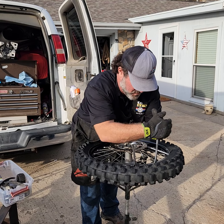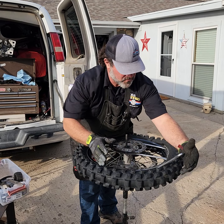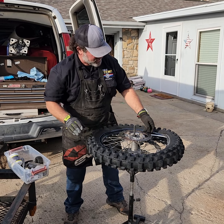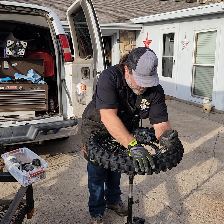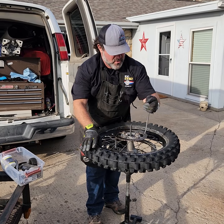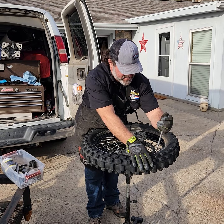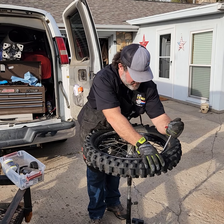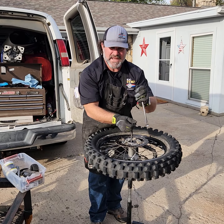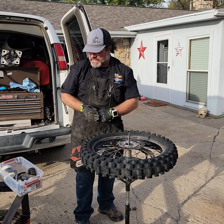Okay, here's Mr. Midnight — both hands nice and controlled, my hand open, back it up with the other hand. Now here's Mr. One o'clock in the morning. By the time you get to here you're pretty much off to the races — it gets way easier. So we just take our time and go a couple two or three spokes, work our way around to that bead lock still right here. Now on that rim lock I try not to get within two spokes of it because you'll put the spoon in there and actually damage the rim lock itself. So kind of skip over it a little ways, then that last little bit pull it like that.